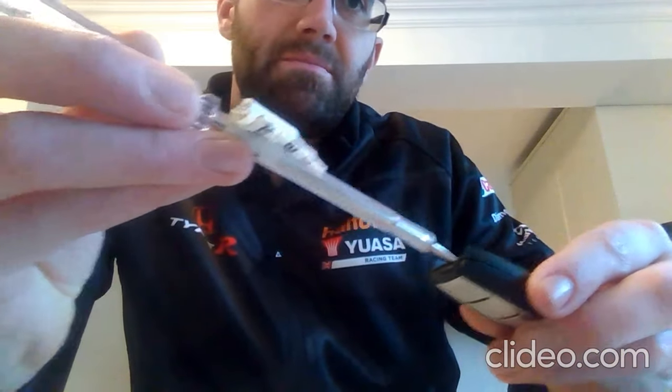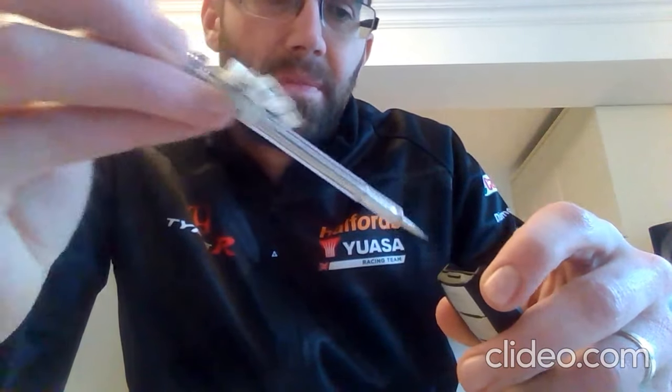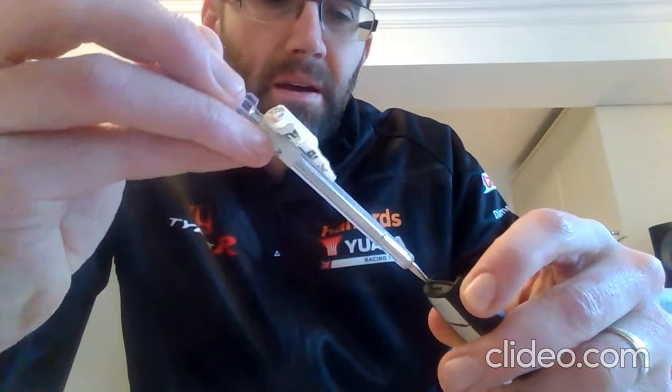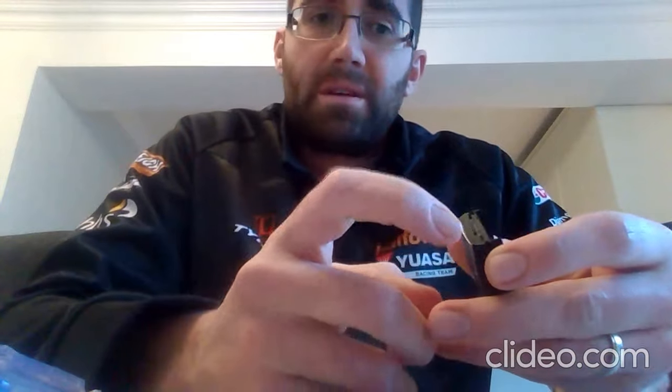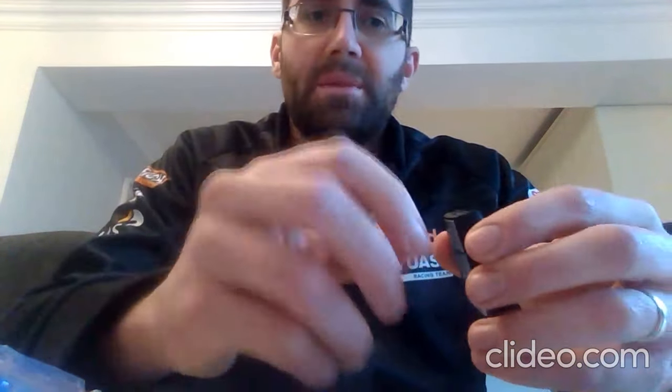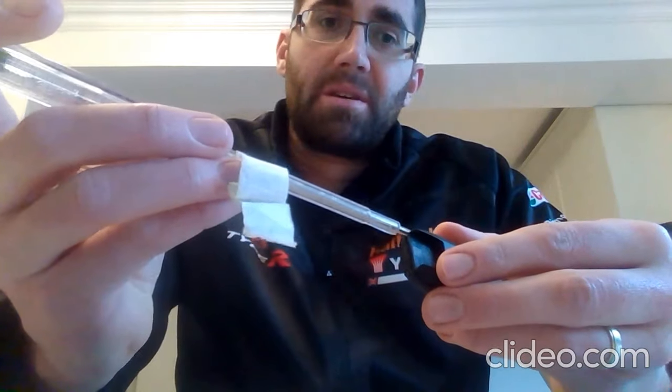And you can see it's starting to open up a little bit on the side. Do one side, and then do the other side. And you just keep doing it, and it will slowly get bigger. That gap, where you can see it's opening up. Obviously, if this hasn't been done in the past in this key, the little latches will be a lot stronger, so you may have to really jimmy it, but just take your time, because you don't want to damage this key too much, and you really do not want to get the blade into the key, because you can start damaging the components inside.